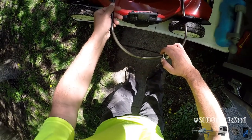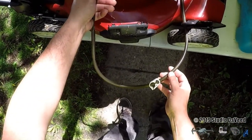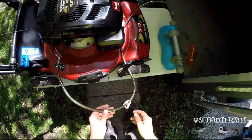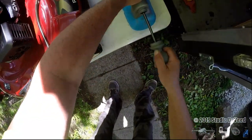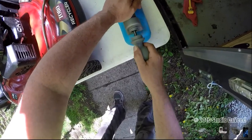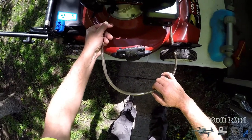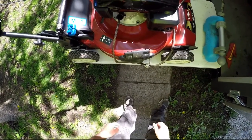Still pulling... and there we see some air bubbles. I'm going to pinch the tube off one more time, add some more vacuum, hit it again — and we're going to call that good. Now we just add the proper amount of oil. Ready to go — quick and easy, no mess.